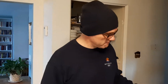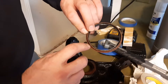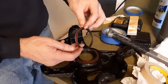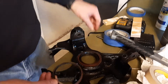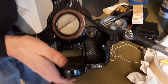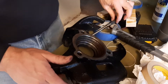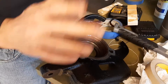Getting it out isn't too bad. Let me show you how I did it and how to put it back in. This is the old seal and you can see it's got this metal lip around it that fits right down inside of there. You want to get on the other side and tap, because that metal extends right to there. I used a punch from Harbor Freight, put it right on that edge, rested it down, and just started tapping, going around in circles — popped it right out, that was easy.